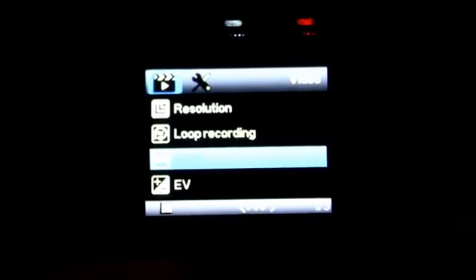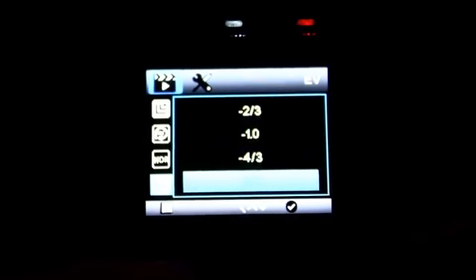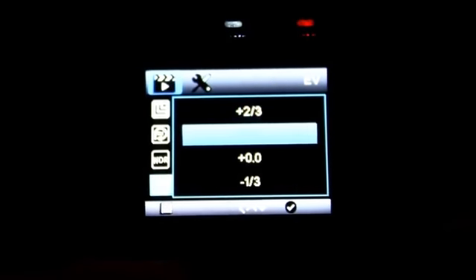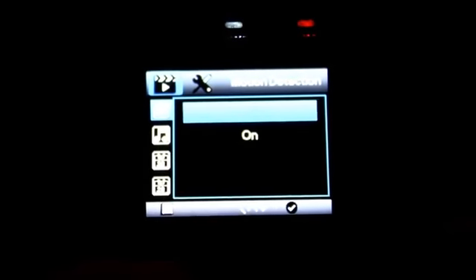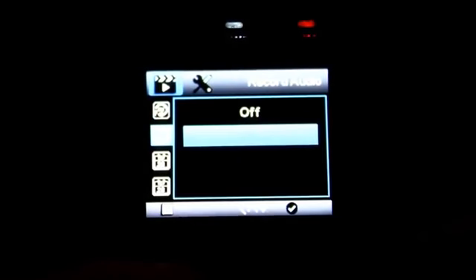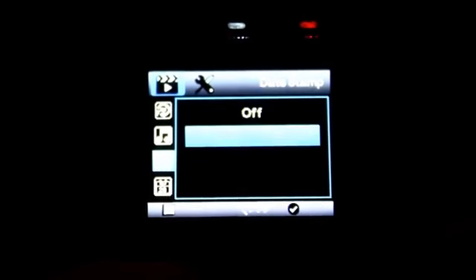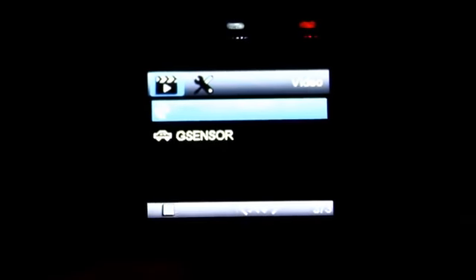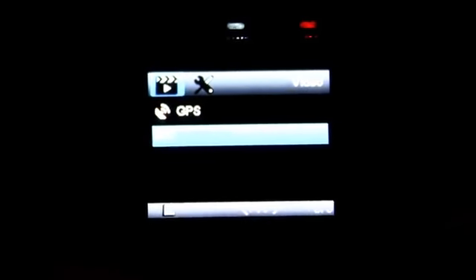Wide dynamic range can be switched off and on — that's for your increased nighttime visibility. Then you have some exposure settings; I've left mine at the standard 0. Next, we have motion detection on and off, which is based off the CMOS sensor. Then we have recording audio, so the microphone on or off. Our date stamp on the footage on and off. Display the Street Guardian logo in the bottom left on and off — I just left it on. Then we have our GPS option, off and on. And our G-sensor: low, middle, high — I have it set to off.